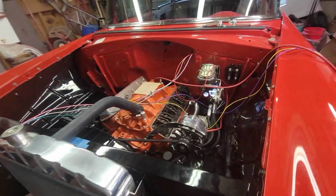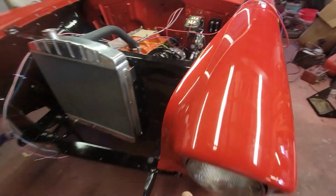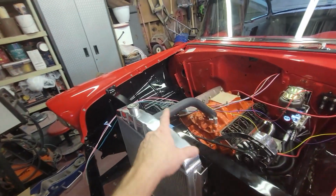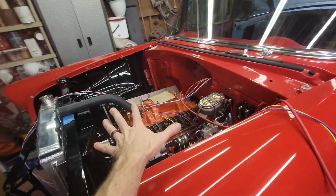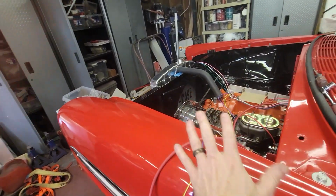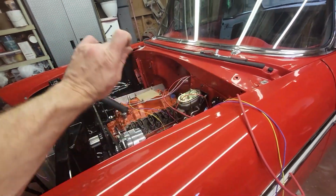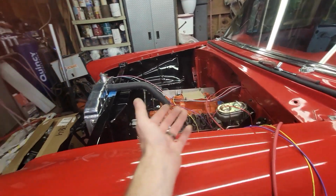There are more circuits that come through here, and I think they're going to come through there, for the headlights, the turn signals, and the horn relays. There's also going to be an air conditioning circuit. So before I lock any of this down, I need to figure all of that out. So I'm just going to leave this sit, even though it says go ahead and connect it, because what it's doing is telling you to replace wires that are in place along an existing route. Well, we're making our route up, so this is the way I need to go about it.